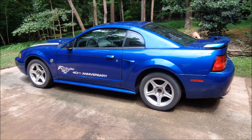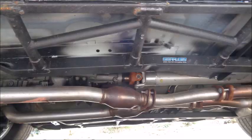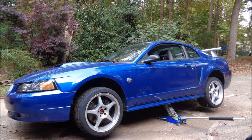But what about the weakest link in these cars — the subframe? I could use subframe connectors and a roll cage to tie the front and rear of the car together, but a roll cage isn't necessary for autocross, and it puts the weight up high in the car, exactly where I don't want it. I need as much mass centralization as possible, but I want any added mass to be low on the body. The best solution is Stifler's FIT system — full-length subframe connectors and jacking rails tied together with web braces. This makes the chassis incredibly stiff, and it adds 42 pounds in the middle of the car as low as possible on the frame. You also get the benefit of being able to jack the car up from any point along the jacking rail.